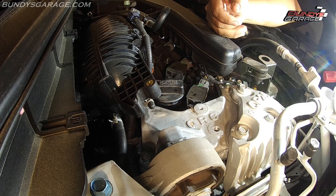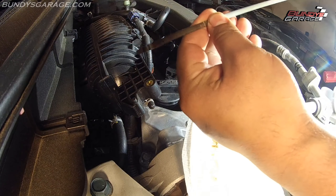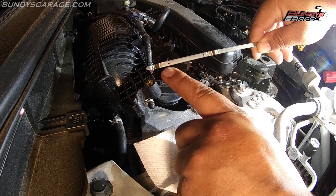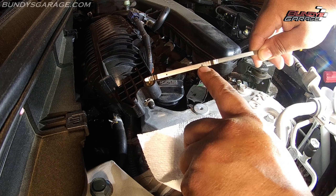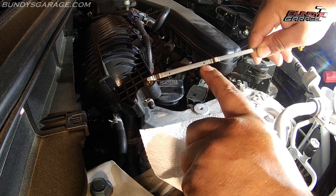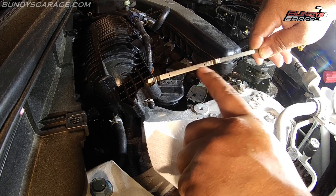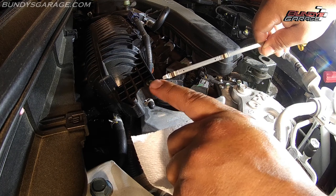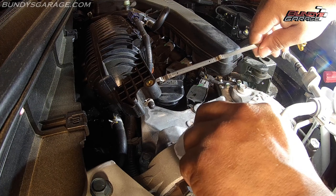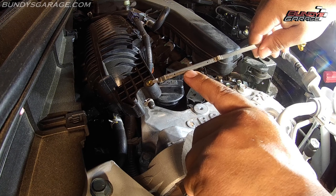Fire up the engine, get the vehicle off the ramps, put it on flat ground, shut off the engine, let it sit five or ten minutes. Pull out your dipstick, clean it off once, put it back into the tube, pull it out one more time, and double-check the marks. There's one hole for low and an H mark — your oil should be at that H mark or right near it. After 100, 200, or 500 miles, if it's in the middle, add some to get it back to the H mark. If it's at the very bottom hole, put a quart in. The two causes of catastrophic engine failure are no oil in the engine and lack of coolant — if you check those two things monthly, you'll be good to go.